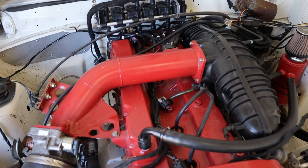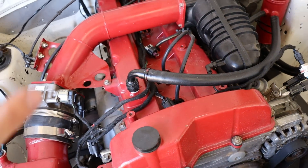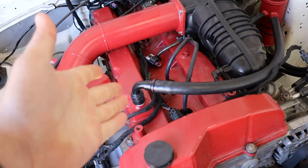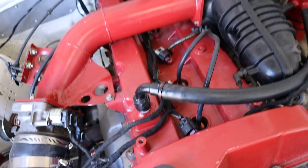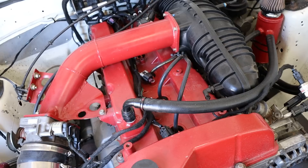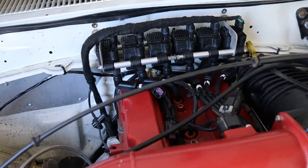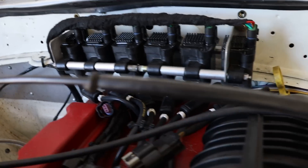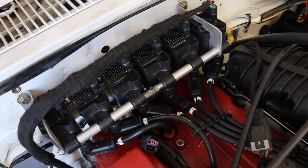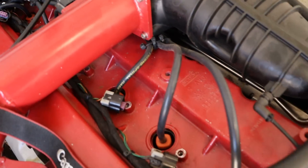When we put the smart coils on the engine, we kind of just laid them here and had short wires coming off of them — it was kind of jerry-rigged and just not really optimal. Now, when you do this, if you have your spark plug wires close to your sensor wires, it could cause noise on those lines, which could cause confusion on the ECU, which could cause ignition breakup. I don't know if that's exactly what caused it, but as you can see here, I've made a very nice bracket that holds all of my Firepower race coils. And I've also done as much work as I can to keep the high-voltage spark plug wires away from the sensor wires.